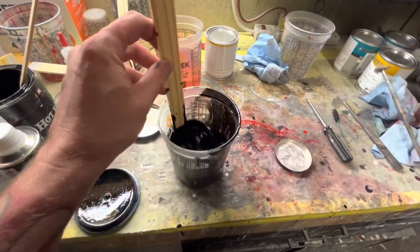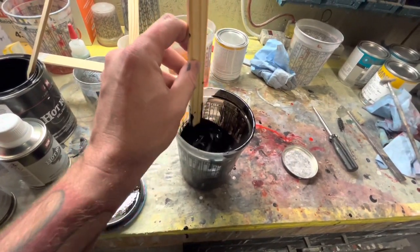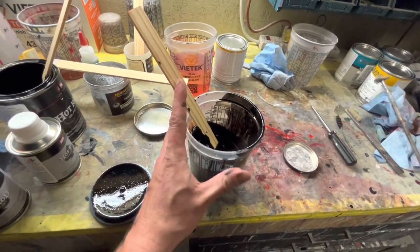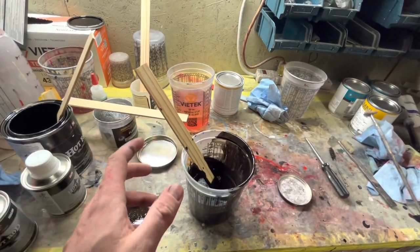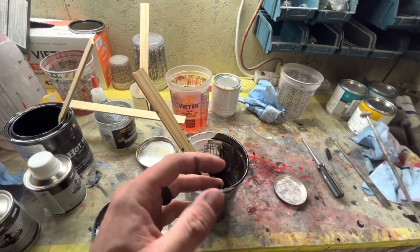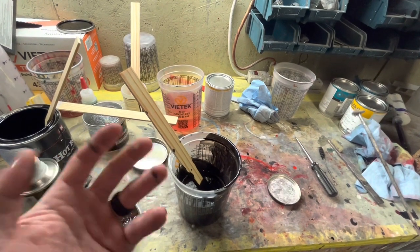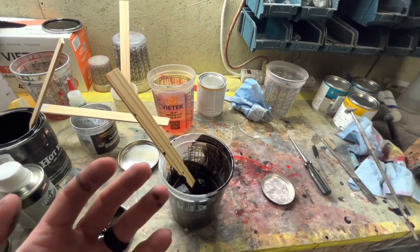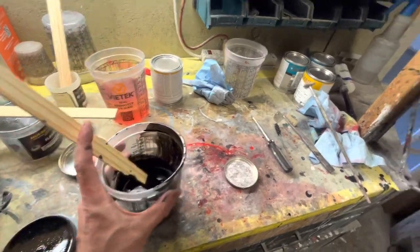I'm about to show you what it looks like. I think it looks a little too textured, which hot rod black is never going to be slick. First off, scientifically it's not how it's designed. Gloss has its shine because of the way it lays down. Satin black has its shine because it actually makes a lot of orange peel so that the reflection can't reflect back to you. It's like the shape of a diamond, like piling a bunch of diamonds together, so it reflects back off of itself. And that's what gives it that hot rod black look.